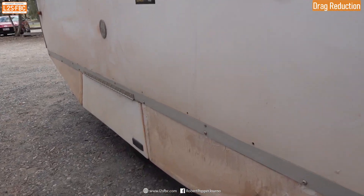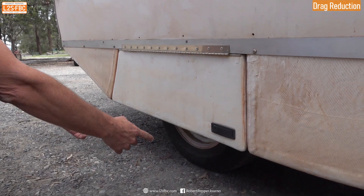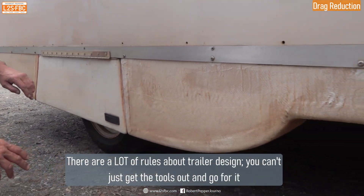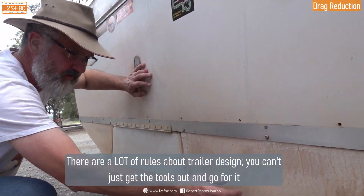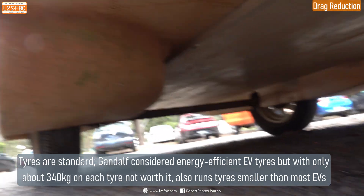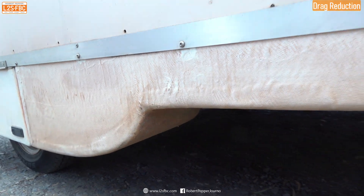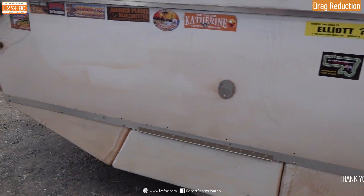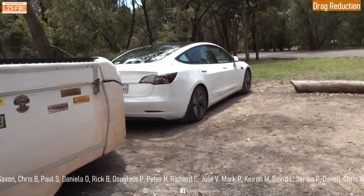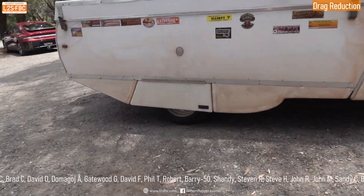I was constrained here with the original caravan. The original caravan basically had the wheel sitting there and a mud flap down the back and that was it. I looked up the rules for what mud flaps need to cover and I've made, again out of foam and fibreglass, an ellipse running in on both sides around the wheels to push the air around the wheels. All in the name of drag reduction — we know from sports cars and Formula One that having an open wheel is a big drag issue. The Tesla has low-drag wheels whereas the car next to us has high-drag wheels.